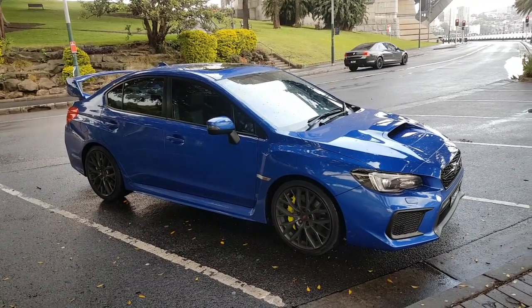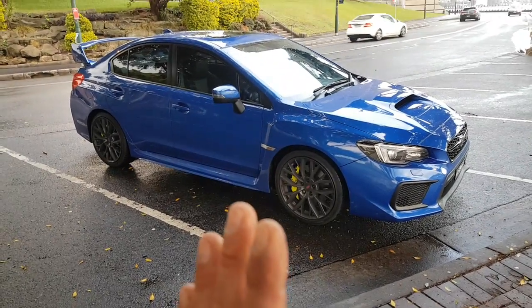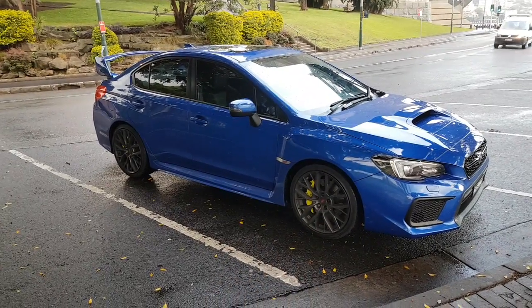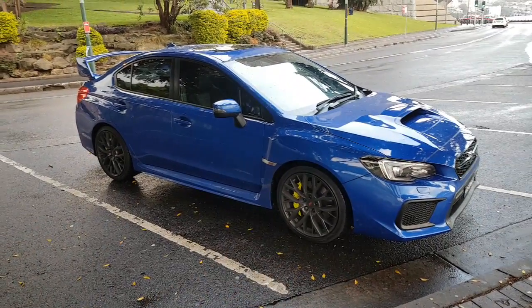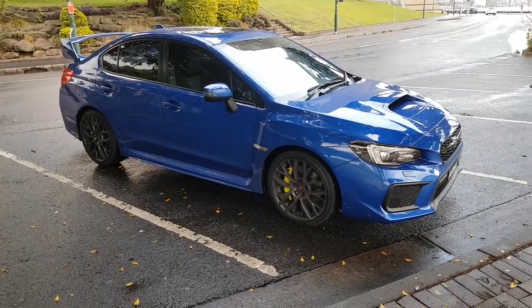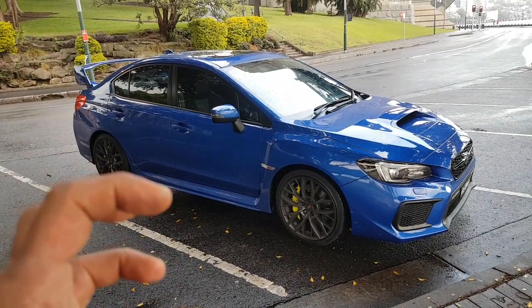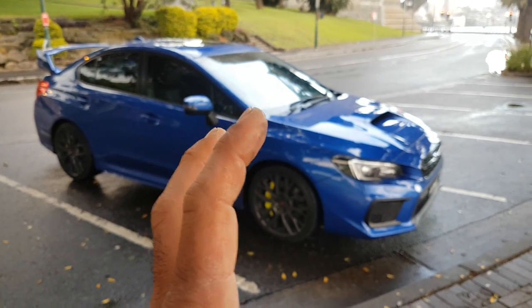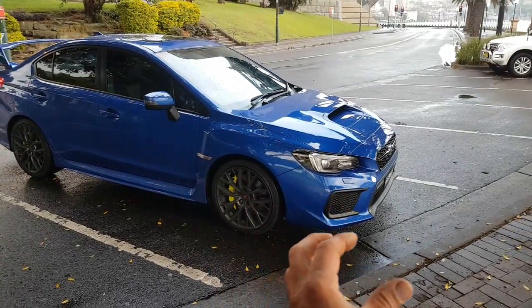The way to check a faulty master cylinder, I'm not talking about ABS pumps and stuff like that: you push your foot on the brake gently and touch it, and it'll slowly sink. Sometimes only when the car's cold, sometimes only when the car's hot. But that's when you go down a hill and descend and you get a big fright. You suddenly take your foot off the brake and hit it again and it recuperates. So it's a recuperating type system as the seal goes back and recuperates, and then you have your braking again, and then only under light pressure, in most cases, will that seal reveal its tiny little flaw and start to sink the pedal down, down, down.